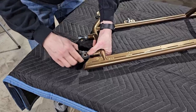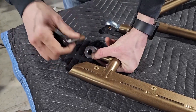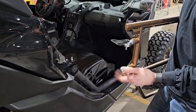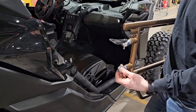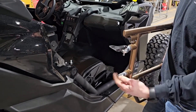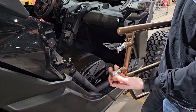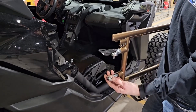They will be a little bit tight when they go in — it'll be snug. They'll break in after you open and close the doors a few times. The bushings can come out — don't worry about it because they'll be encapsulated. So as a general rule of thumb, when they're all the way threaded in, you're going to turn them out about seven to eight full turns. So there's one, two, three, four, five... all right, so there's eight. Do the same with the top.